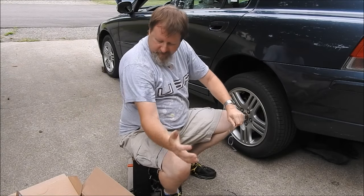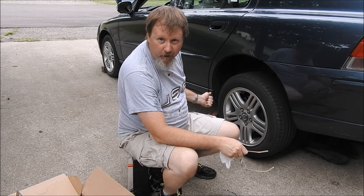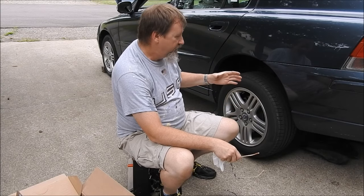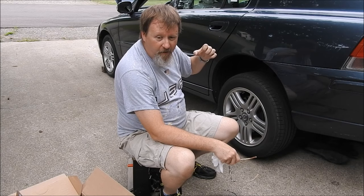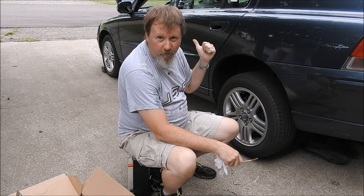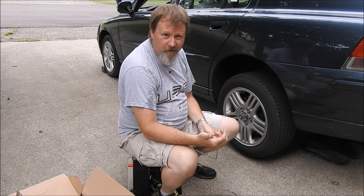Okay, we're back. I've changed shirts into something I use just for painting and doing work, so I don't have to worry about it getting messed up. I have the car up on jack stands already, with my jack on the side I'm working on as an extra precaution. I have chocks — just some blocks in front of the front tires so the vehicle doesn't roll — on a level concrete surface. Because I have to compress the piston in the brake cylinder, I also have the top off of my brake fluid reservoir and made sure there's enough room for liquid to rise up. When I press that cylinder in, it's going to push that fluid back into the reservoir, and if it's too full it will overflow. You can take some out if you need to — one of the easiest ways is a syringe you can get at a feed store for vaccinating animals.